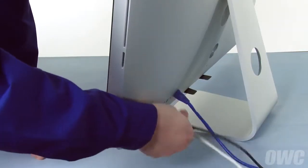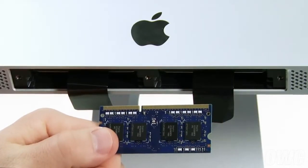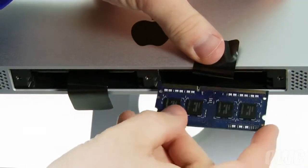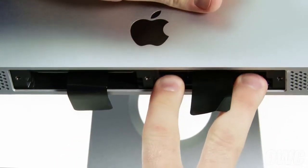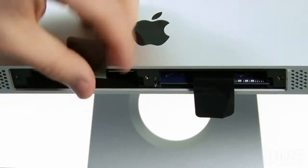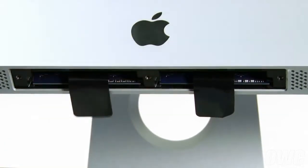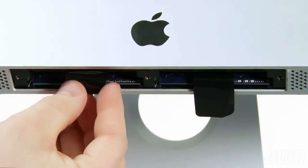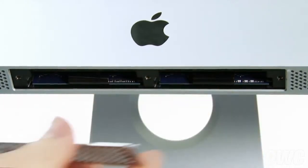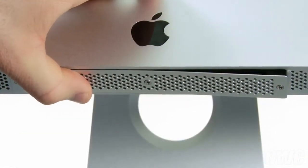You can also unplug the cables from the back if you don't need them. With the iMac facing you, position the memory so that the notches are facing towards the left. Then slide it into the slot it was before. Then, gently but firmly push on the module until it snaps into place. Do the same thing with any other modules. Once all the modules are installed, fold the black tab over and tuck it under the memory like before. You can now replace the bottom cover. Get the three screws started, then adjust the door as you tighten so that it closes flush.